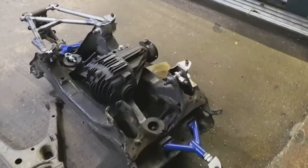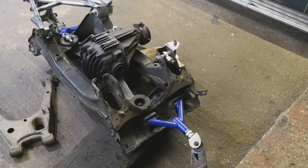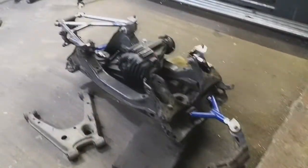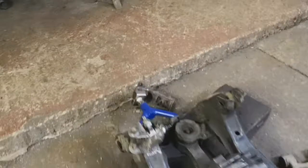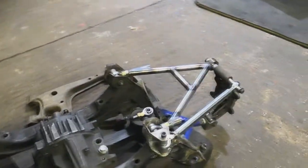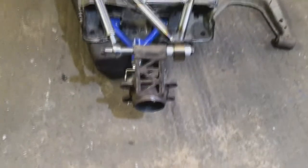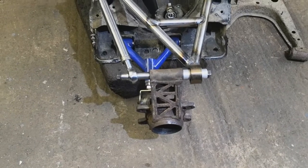For this video, I'm going to try and make the other wishbone over the next few nights and will try my best to film it. I'm also going to order up some bearings and try to get the hubs built back up. The hubs could all be cleaned and painted now, and since I need to make new uprights, I may just rattle-can them for now and worry about fancy powder coating after it's all been tested. Then I'd like to make new ones out of 4130 or something stronger than mild steel. Cheers.